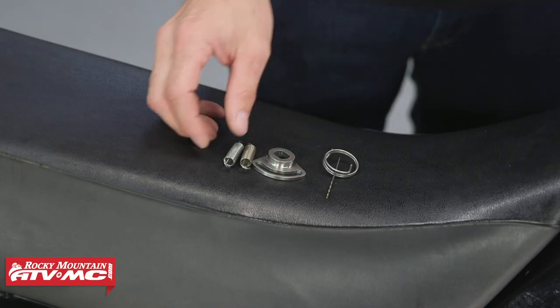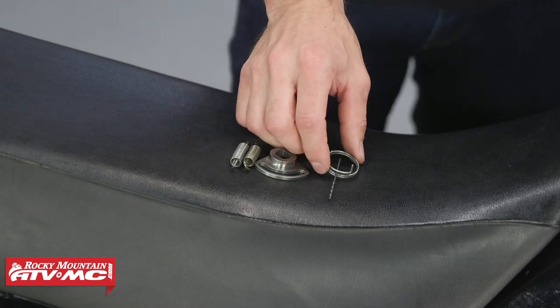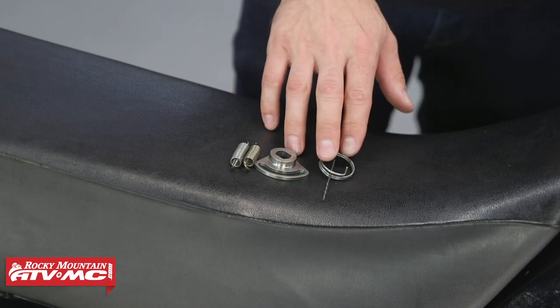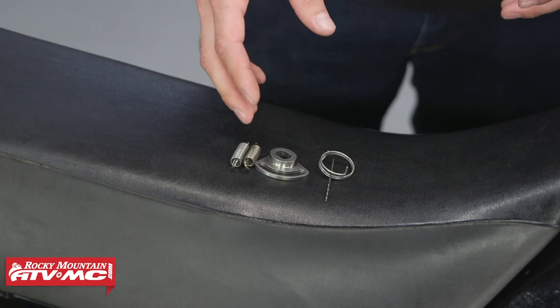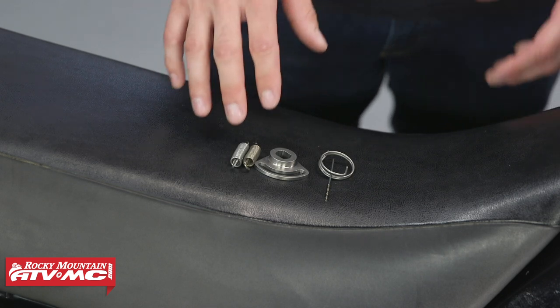Now, if any of these failures happen, your counterbalancer will get out of time and any of the broken parts can eventually lead to a catastrophic engine failure. So the doohickey does come with these upgraded heavy duty springs, but we opted to go with the torsion spring. It comes with this drill bit too. And the reason we're using this is that it puts direct tension on the doohickey and eliminates any slop in adjustment. And we'll show you more about that when we're actually doing the process.